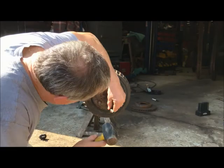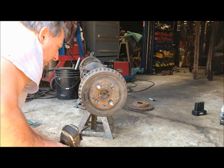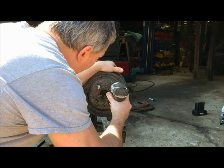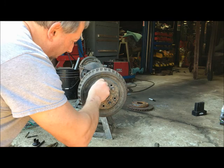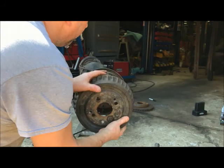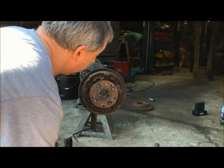All right, so drilling holes using the... So I drilled four holes, not to their final diameter yet. One of them might be off a little. The drill walked because I had drilled the center hole before bolting down the drum. So bolting down the drum should have been the first thing.